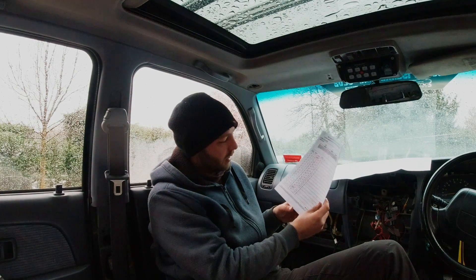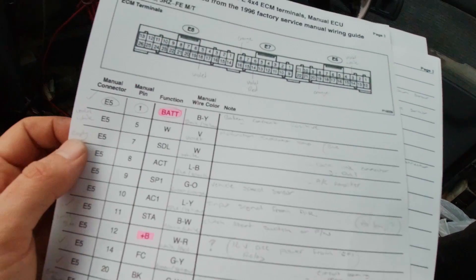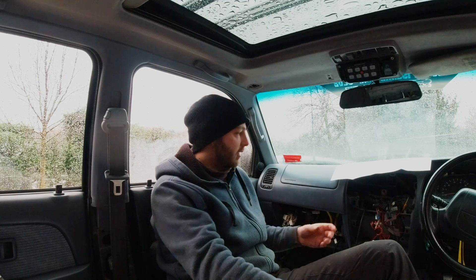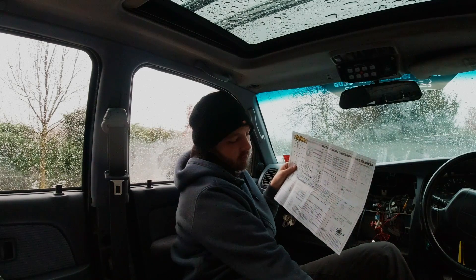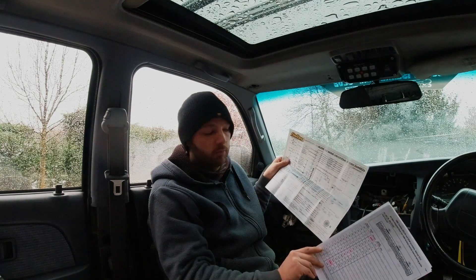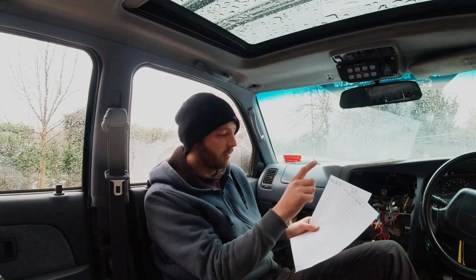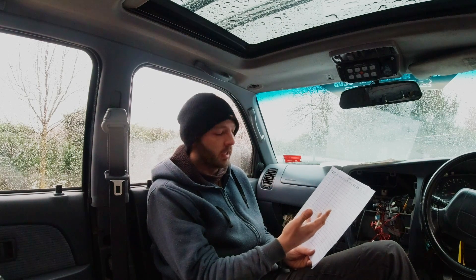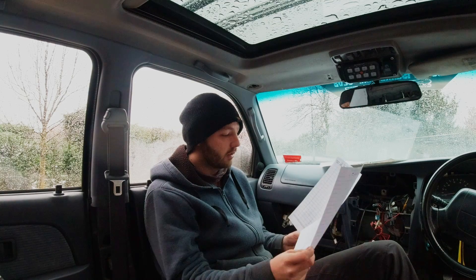Which is then recorded on this highlighted sheet — this is the pinout for my ECU's plug. I've gone through and recorded everything: what it does, where it is, what color the cable is, and then highlighted the ones I actually need. This one is the Haltech 750 Elite's pinout. So between these two, I had to figure out which pin on one goes into which pin on the other. I've labelled the pin number on the Haltech unit with what it is, and next to it the pin number of the 3RZ unit. Now I just need to cut these ones out, plug them in, and we should be good to go.